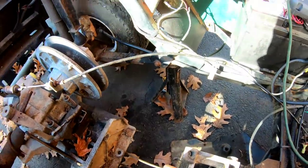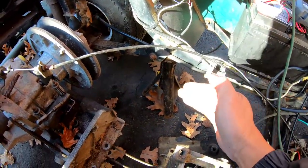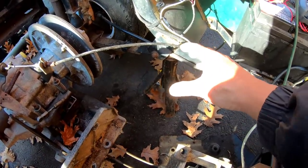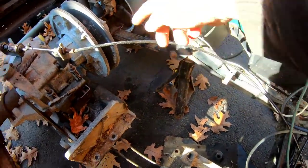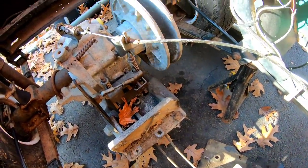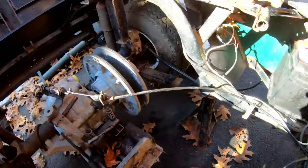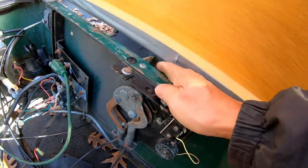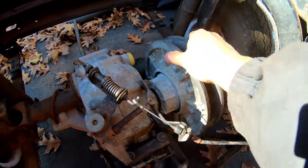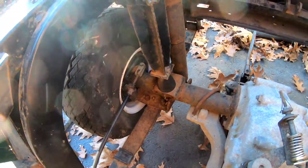Look, all we need is for the crankshaft drive clutch to be around here, right? That's all we need, so that a belt could be looped around for the transmission pulley. And by the way, I tested the transmission, it does work. I put the thing into gear, and here, I'll show you. There we go, that's forward, okay? You spin the wheel, the pulley I mean, and the wheel moves, see?